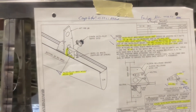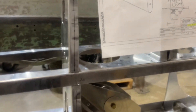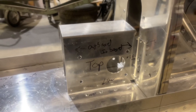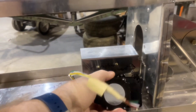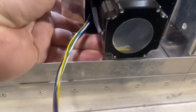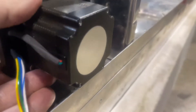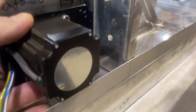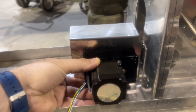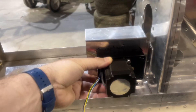It was designed for the Dynon following the plans - I lined it up but there weren't any specific measurements from the top to ensure the clearance was right. I lined it up as best I could with the bell crank, and what we notice is with it in place it won't sit down because it sits right there against the spar. We'll end up pulling that bracket out and either using a new one shifted down, or modifying this one - we'll do some experimenting to see what works best.